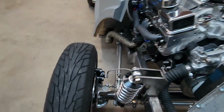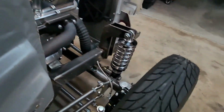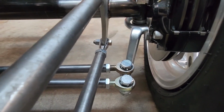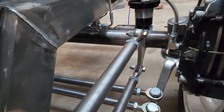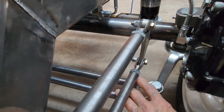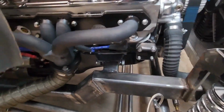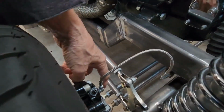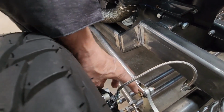The other probably more significant thing is that the second set of steering arms that Lou picked up were not quite dropped enough, so he went and got a third set, which is a 3.5-inch drop, and that solves the problem. In fact, it was so low that the rods were moved from underneath to above, but that's fine now. There's plenty of clearance. The wheels are now turned, and when they turn, they'll actually go till this brake fitting stops on that nut. So maybe not all bad.